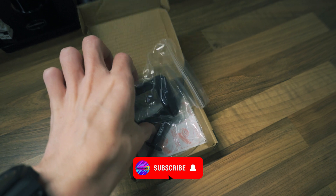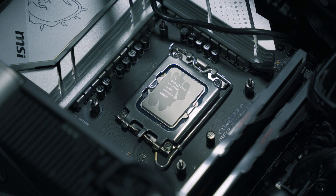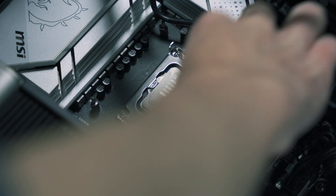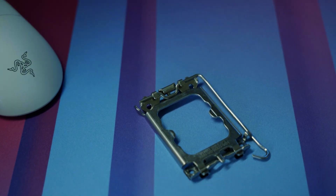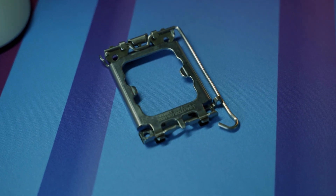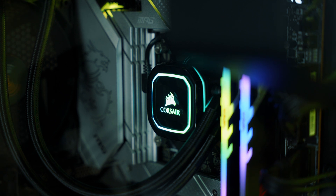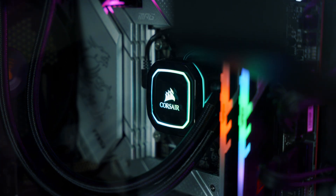For those of you that don't know what a contact frame is or why you would even need one — the main reason is Intel's engineering isn't too great. The integrated loading mechanism on the LGA 1700 socket is not great at all. It is prone to bending LGA 1700 CPUs, which will reduce the contact patch between the IHS of the CPU and the cold plate of the cooler, therefore increasing temperatures.